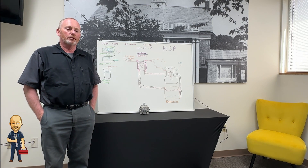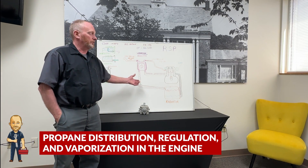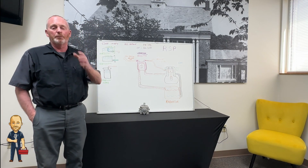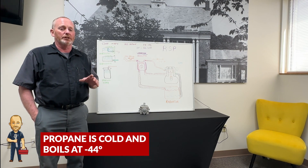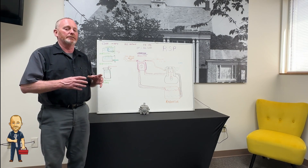Today we're going to do a quick tutorial on propane distribution, regulation, vaporization, and how it works in the engine. One of the important things you have to know is propane is very, very cold — it boils at negative 44 degrees. So what we do to use it is we put it under pressure in the tank.